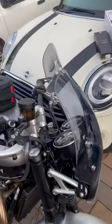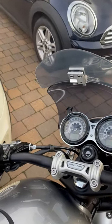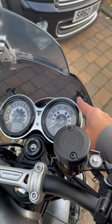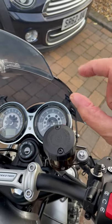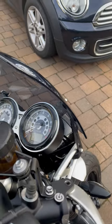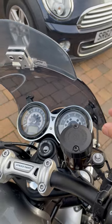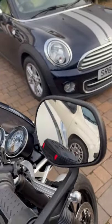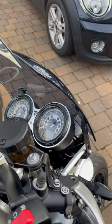I definitely recommend the two together. One thing I did find though is that when I put the Puig on it made the screen shake a little bit. So I've made some rubber spacers here to fit in front of the standard mounts for the Dart — basically just cutting up a piece of old hip armor and gluing them together in pads. This is the first go at it; they'll probably look a lot nicer when I finish them. They use the pressure between the clocks and the screen to wedge into place, and it does make it a lot less vibration. I'll make them tidier and smaller on my second or third attempt, but you don't need them unless you put the Puig on — I think the Puig just makes it shake that little bit.